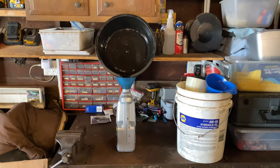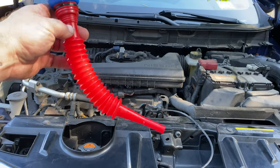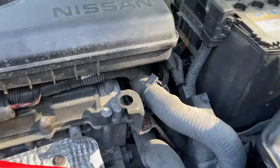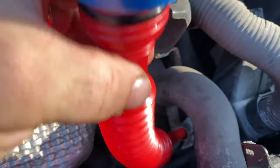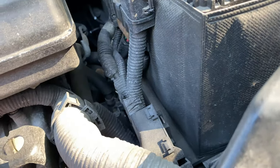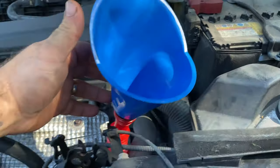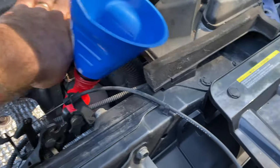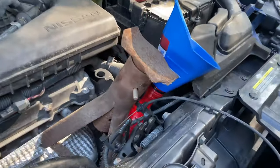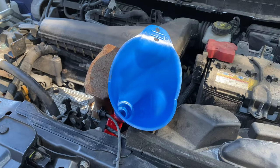I've already put the plug back in. Putting the fluid back in through that tiny hole is going to be tricky. To accomplish this, I got a funnel with a flexible spout — it has to have a small, small end on it. Get it right into the tube, tuck it in, and make sure it's seated firmly. That's going to let us bend the spout up so we can easily add the fluid. I put an old jack stand behind it to hold it in place so it doesn't spill. That'll hold it while I fill with approximately three and a half quarts.